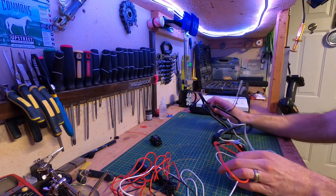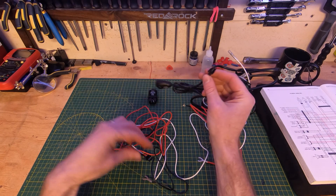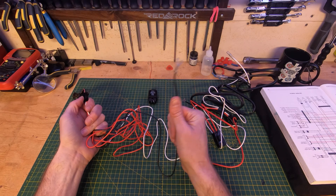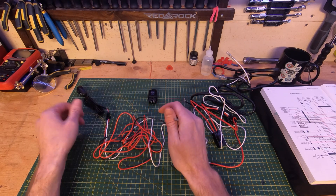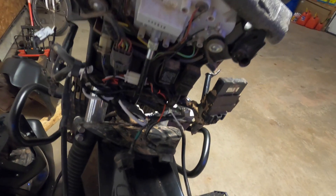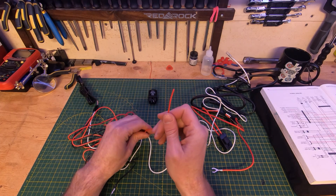That's the main power side of the circuit. The other side is where we get the control power from. The control power goes to the switch, which is included in the harness. You have two ends — one is a ground, which can be grounded to the area by the horn, or there's a really nice spot behind the instrument cluster. I found a really good ground there on the instrument cluster screw. You can test that with a multimeter for continuity just to double check.